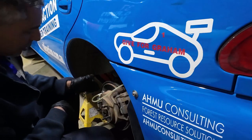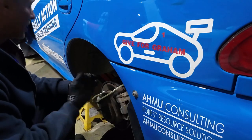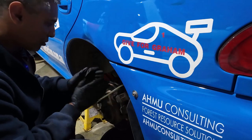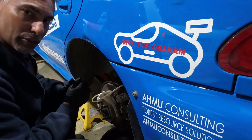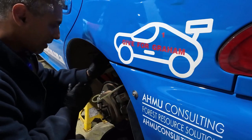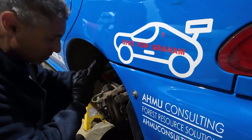I'm using a single-man bleeder because I don't have anyone helping me in the workshop today, and these work just as effectively. The only caveat: if you have a brake bias valve fitted, set it to the middle position so fluid flows through it without too much restriction, which allows the master cylinder to push fluid through fine. We'll bleed this up and get all the air out. If you're using braided brake lines or any kind of brake fitting, as you're bleeding you've got to go around and check all your lines and fittings - there are quite a few fittings in this car including the T's at the back, right from the master cylinder through the car.